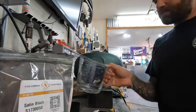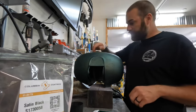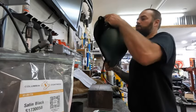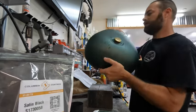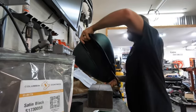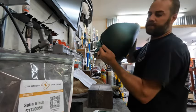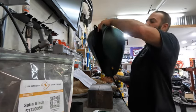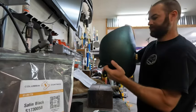This is when you want to have your buddy, your kid, someone over to help. At least it's a small tank we're dealing with — not a big automotive tank. We're going to rotate, roll, and shake, because all you're doing is taking off that coating that the gas leaves, that residue. The next step — when you etch the metal — is when it really starts to break off any of that surface rust. Then it's going to be completely dry before we add the sealer. So there are a few steps: this being the cleaning and degreasing after we already rinsed it.